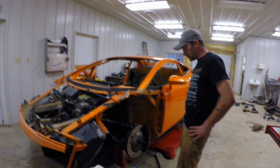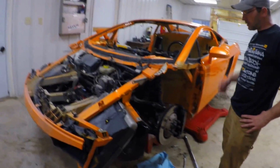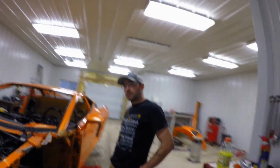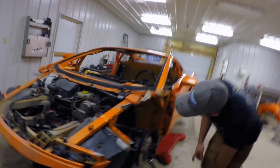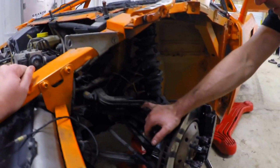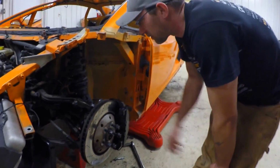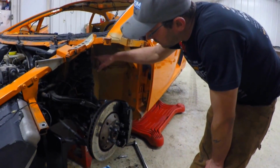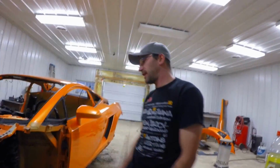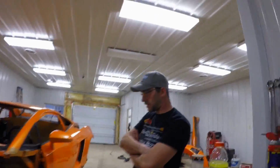Cody Toby's going to take care of some custom suspension bits for us here and try to get us the 15-inch brake conversion from AP Racing, as well as some custom adjustable control arms front and rear. So that'd be pretty cool. And if they do that as well, they can relocate the lower shock pivot further in and get more up and down out of the knuckle versus shock stroke. Okay. So great, you have to change your spring rate at that point, but it'll give you more travel using the same stroke shock.